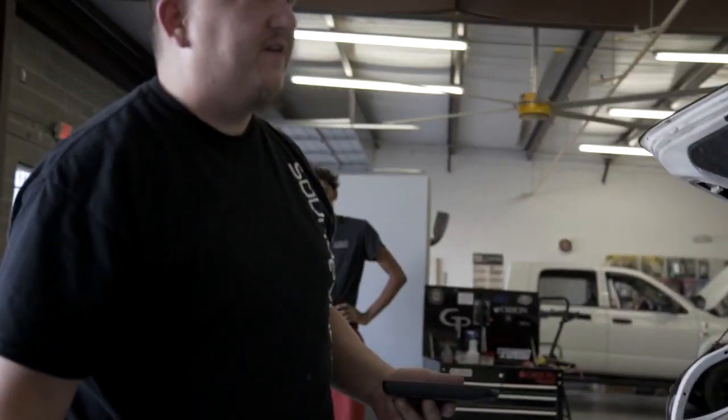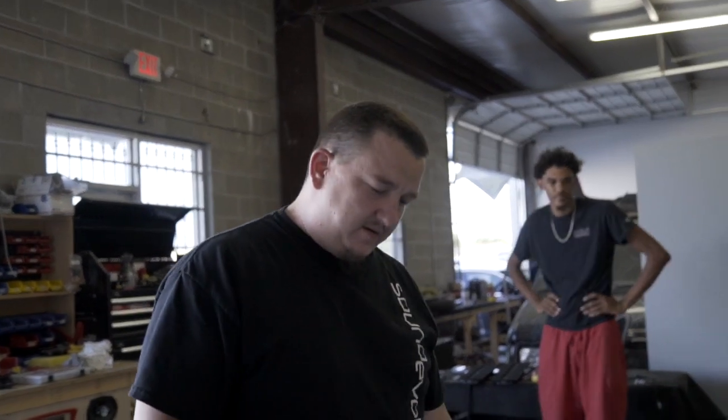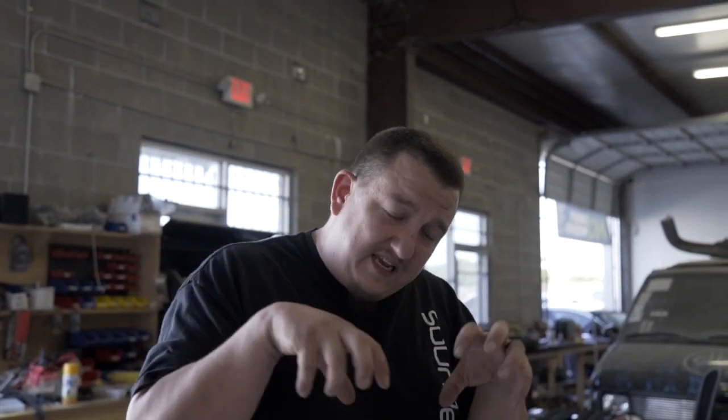that's fine. That's about 1.5 rise. Okay, that's fine, I expected that. If they made them in dual ones, though, that'd be awesome. You hear that, Sundown? Dual ones. We like that half-ohm stuff. You take two of them, wire them together, half-ohm. So you start off 6,000 watts on a 5,000 watt amp.